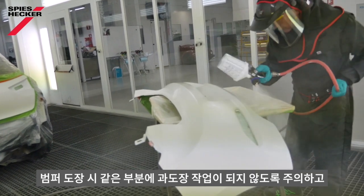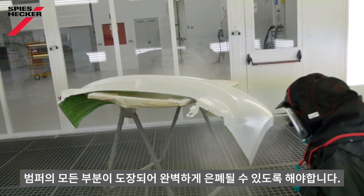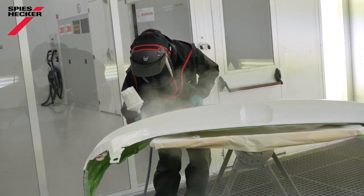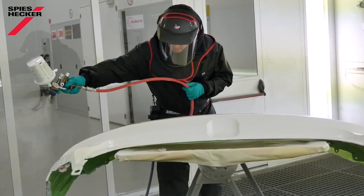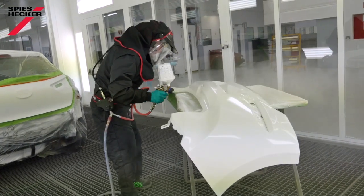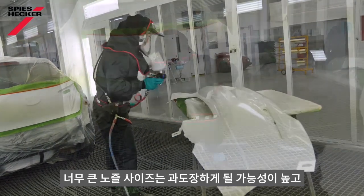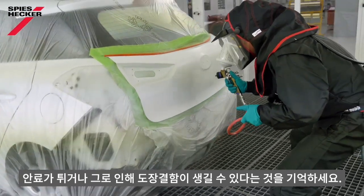Painting this bumper, I need to be careful that I don't over-apply the same area too many times, as it's necessary for me to paint all of these little complex shapes to make sure that I have full hiding. Choose a spray gun that is in line with the recommendations given in our technical data sheet. Remember, too big a nozzle size will over-apply the material, and can lead to problems with splashing and defect formation.